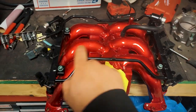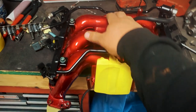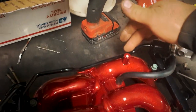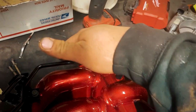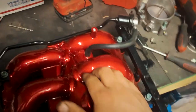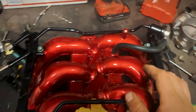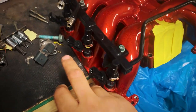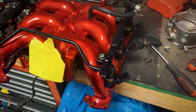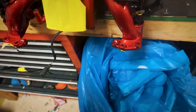This is my fuel rail — I ended up cutting all the cross members just at the tabs so I don't hurt anything. For the single turbo I just kind of pulled it inwards, because this one crosses straight and you have to push it inwards — it doesn't take too much force. I ended up leaving this vacuum port so I could get vacuum for my 4-bar sensor. Thousand CC injectors with adapters from Project B5 — I'm waiting on my other stuff from Project B5. It didn't show up yet because we have a storm coming here in Tahoe.